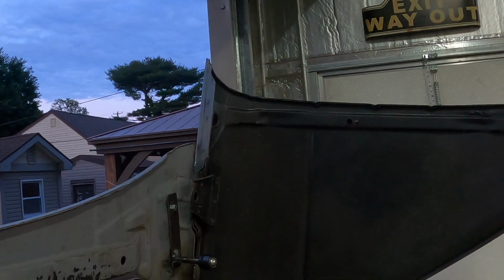We had talked about maybe hitting this in just a little bit right here, but I don't know that I have to yet, and I'm not going to go there because I don't want to interrupt the movement of the hinge. That'll be like a last resort try. For right now, one thing I noticed is I should have taken all this bracing off. I got ahead of myself, and I wasn't thinking, so I got to surgically remove this because we don't need any of this anymore. Where that was dragging on that bump out, I already notched this out right here, and I notched into the lip a little bit, and I'm hoping that's enough. I got to repeat that process on the other side, and I will work on that this week.